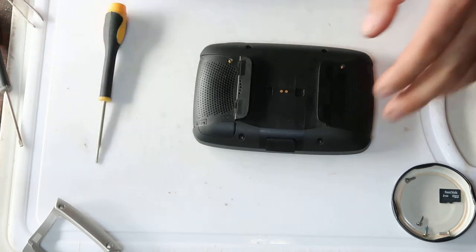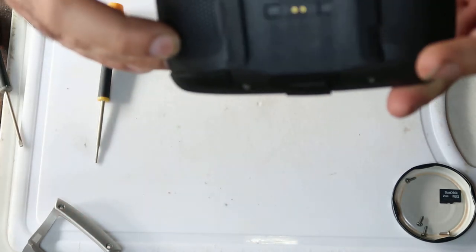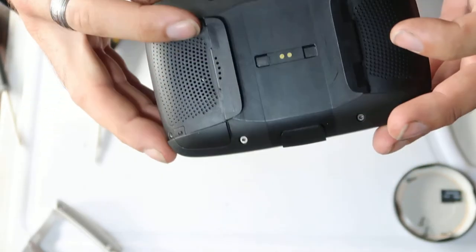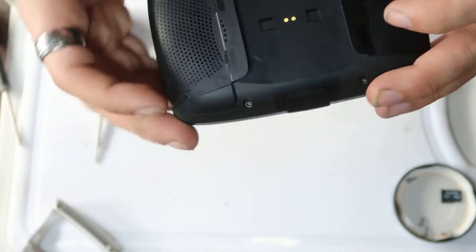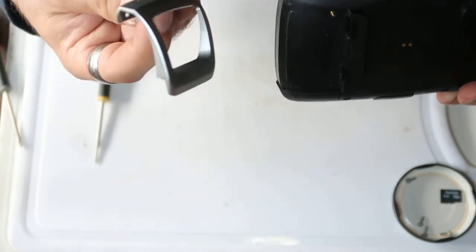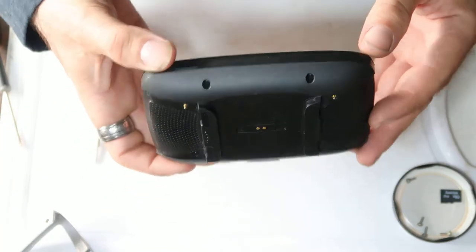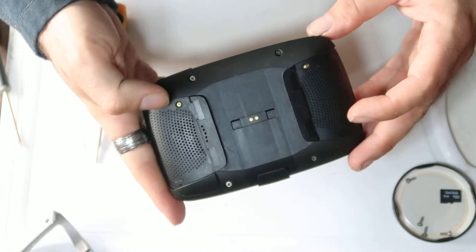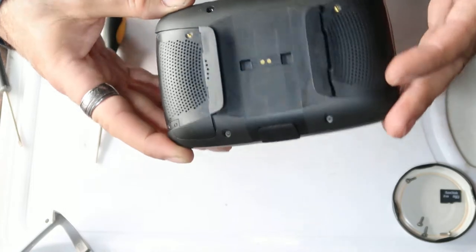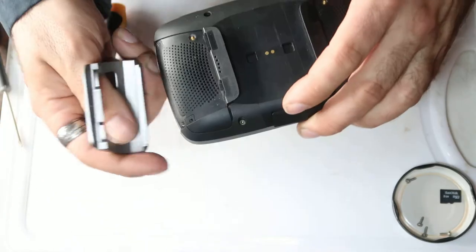There we go. As I was talking about earlier, with it voiding warranty, there's these two pins here, interestingly, spring-loaded little contacts. I think they're an anti-intrusion measure, so that the circuitry knows when these units have been removed. So I would guess that if your unit went off to Tomtom and you said, it's broken, I want it fixed on warranty, they're able to say, well, you've already tried taking it apart and you've voided your warranty. I know of other electronic manufacturers who've done that before.